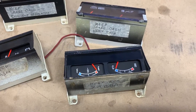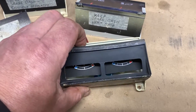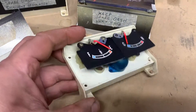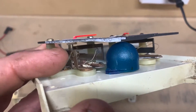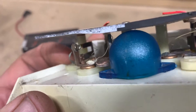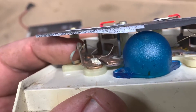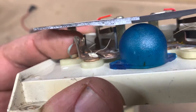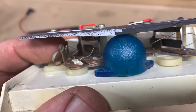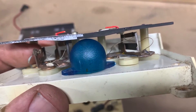Let's have a look at where this actual regulator lives — it lives inside the fuel gauge here. I've already taken these apart to make it easier and quicker for you. This thing here is the actual regulator. It's not very fancy and not very complicated. What happens is when voltage goes through it, this opens up and closes very fast, and that effectively reduces the voltage — the amount of power — going to each one of these gauges. It's a very basic sort of device.